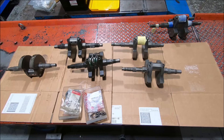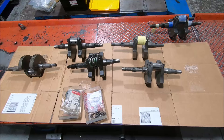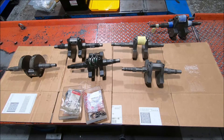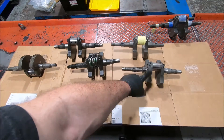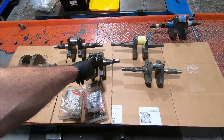That's about all I can think to tell you about crank variations. There are lots of stroke variations and you can sort of mix and match - the only difference is the big end sizing. Small block means 350, 400, 500, 600, 620, 650, 695, 696, 659, 750, 796, 800, Scrambler 800 - all those things are small block with a 40mm big end pin but the same mains. Whereas all the big block engines - all the four valves, the 900s, ST2s, and 1000s - are all 42mm on the big end.